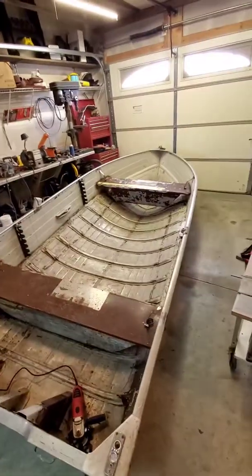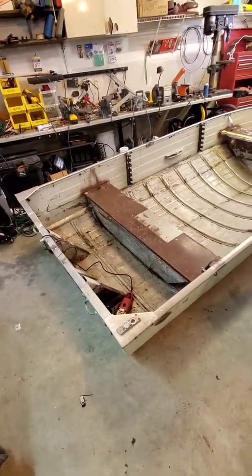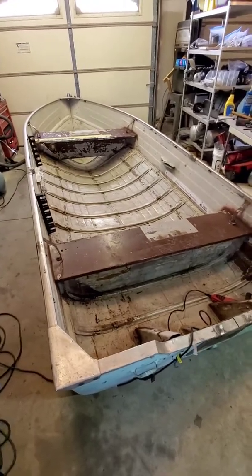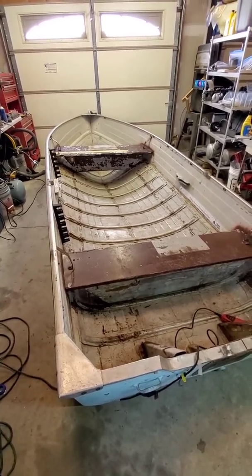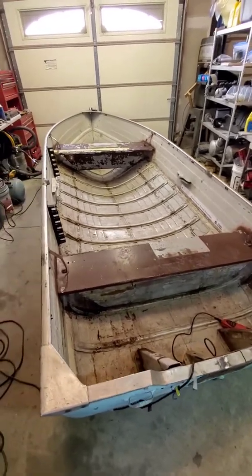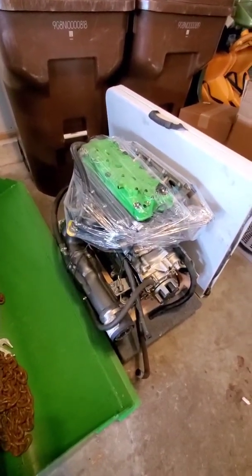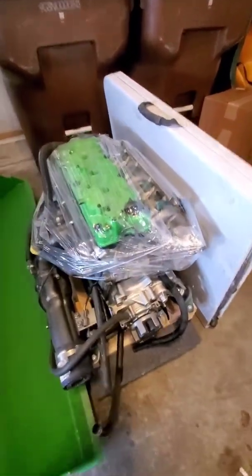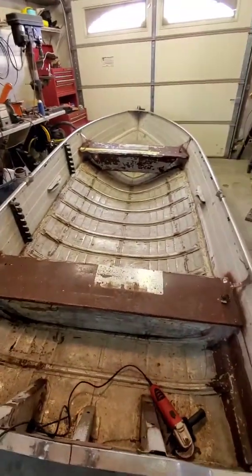What we're going to do here is I've got this old aluminum boat - it's pretty deep, it's got a deep V to it. I rebuilt a Kawasaki STX-15F jet ski motor. This is a last minute video, so I just figured I probably should record and document. We've got this in the garage for the first time, ready for teardown. I already rebuilt this motor - it's a STX-15F with increased compression, bored out to 1.6 instead of 1.5, so it's going to have some more horsepower. That's ready to go - I did that a few months ago.